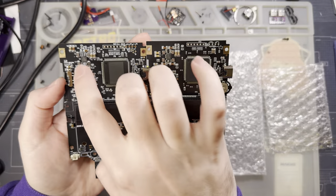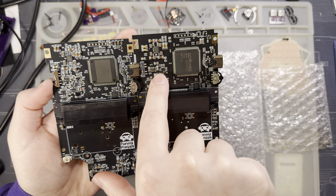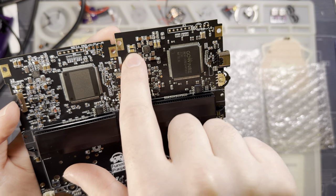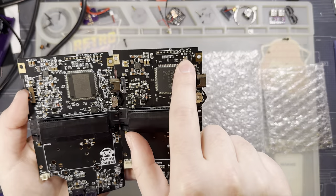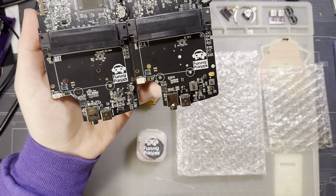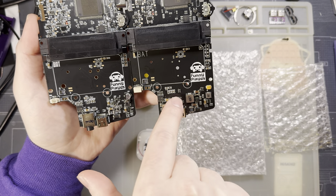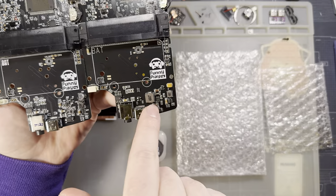They've also stopped etching the markings off these chips — I don't know why they ever bothered. All the power supply circuitry is the same. The difference is they've taken away the component labels on the board, so whereas on the old version you could look and go 'oh yeah, that's C2,' on this one nothing's there. Those capacitors are in a different spot too. The IR blaster and receiver are still unpopulated, but otherwise it's largely the same. Down here on the bottom half it's basically identical, though I'm noticing a slightly different layout of some of the parts.